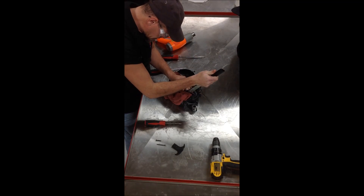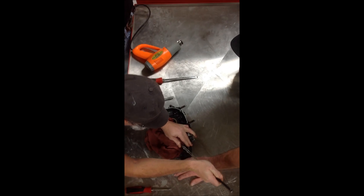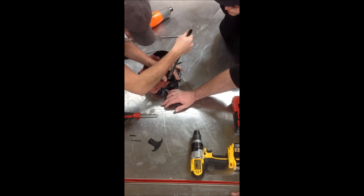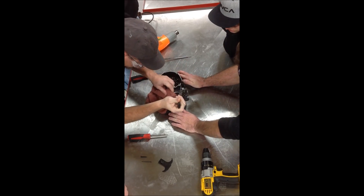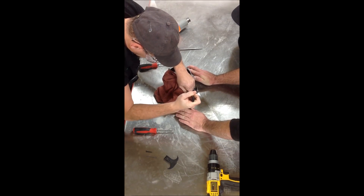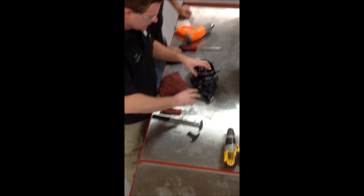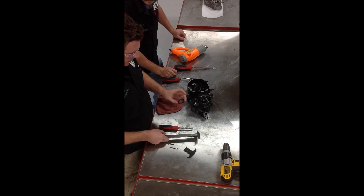Take your time with it, and if you're struggling, stop, look at it again, get a flashlight out, see what the problem is. If this seal is installed properly, it should be in there. He did that with no effort — just took his time, worked around the case, didn't damage the case. That's how you would properly remove this with this tool. We saw videos where you grab onto it and pull it off — those are really cool tools, especially if you have a shaft through there. We're going to grab the crankshaft and demonstrate what it would be like to remove the seal with it installed.